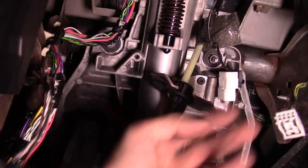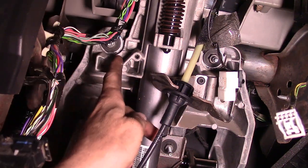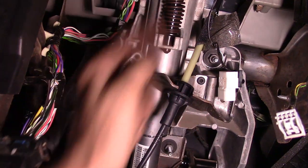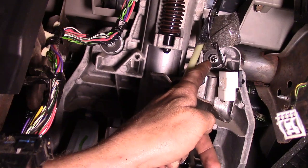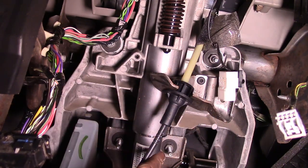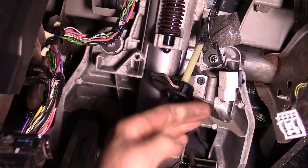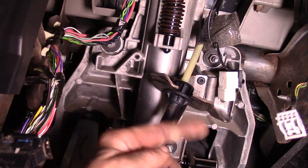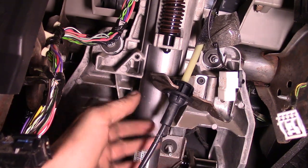In order to drop the steering column we've got a total of four bolts we need to take off — they have 13mm nuts on them. We've got one right here, one right there, another one here, one right there, and another one right up in here, so you can actually see the four 13mm nuts we're going to be taking off. If you've got adjustable pedals you may run into a fight to get the steering column down because you've got some brackets in the way, but it will go. We'll start backing off all these 13s and leave one in place at the end so we can hold the steering column up while we take it and then lower it down to the floor.